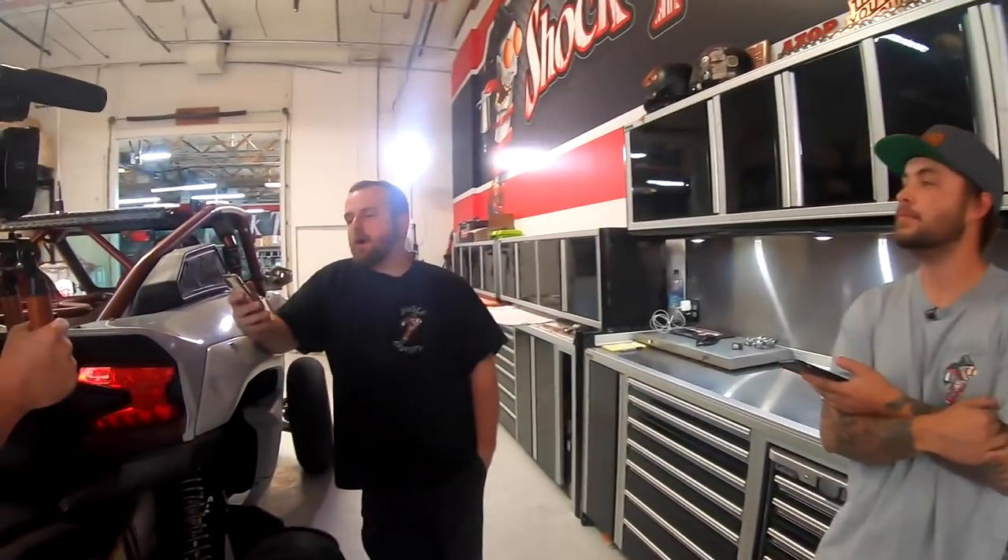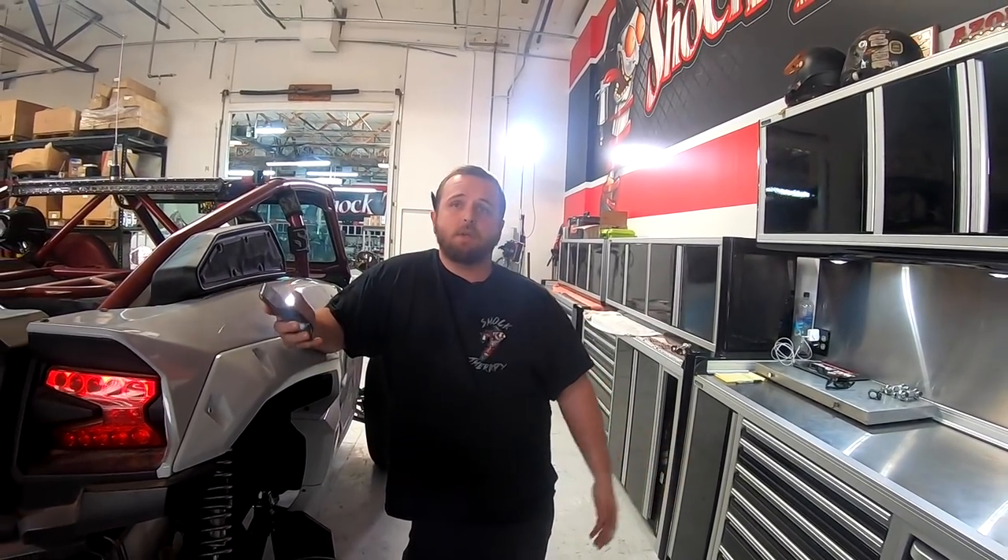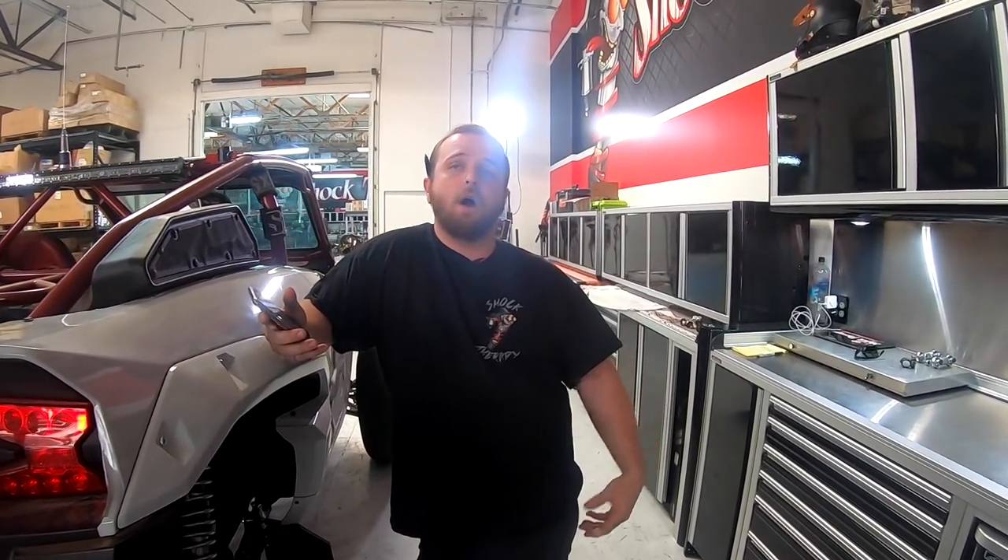Is it hard to figure out spring rates when you have a very heavy driver? We have weights, sandbags, and dumbbells in the shop. If we have a 285 or 300 pound driver we throw dumbbells in or get one of the bigger guys and throw less weight in. We use sandbags to duplicate that driver's weight. In the event that we only have the shocks and not the car, we use the mentality from when we had a similar car here, using notes from previous builds.